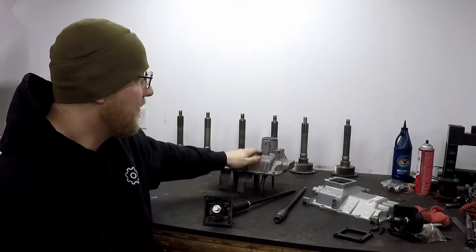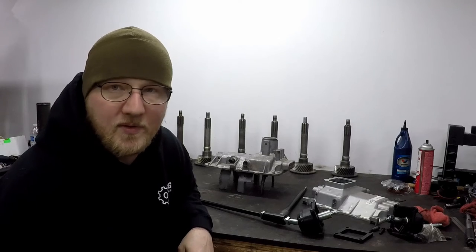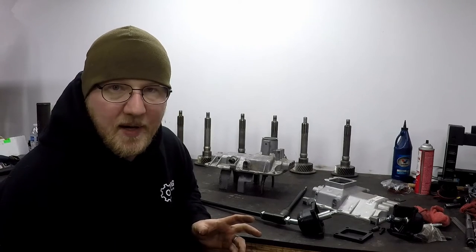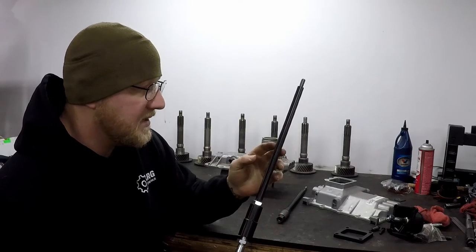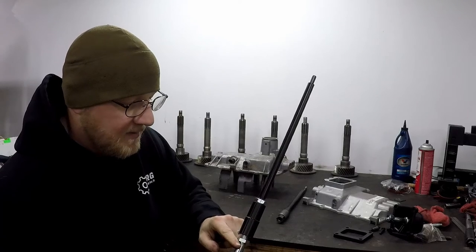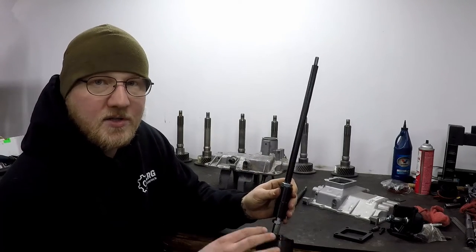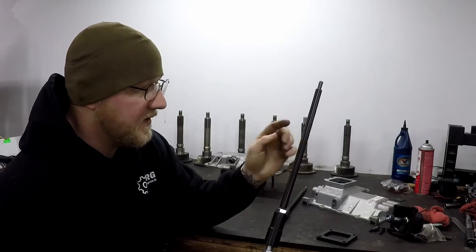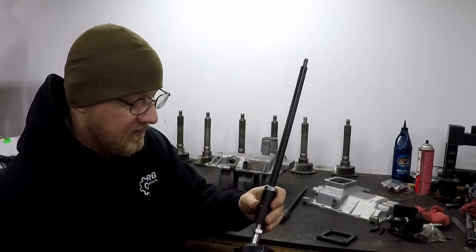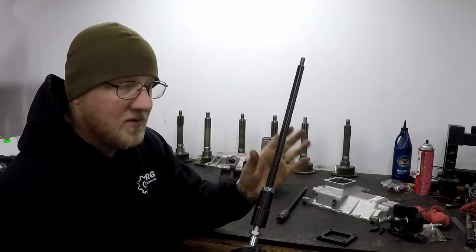That's what we do — I just wanted to share this little tip. I'm going to be doing a video about how to actually convert a round top to a square top and show what parts are necessary. The shifter part number is 334625A — I believe without the 'A' at the end that is the Dodge spec one, so make sure to add the A and you'll get the GM threaded rod which is way cheaper. Then go to Advanced Adapters and get the GM NV4500 shift lever to match the GM thread. For those of you who already have a Dodge shift tower, you can get this same exact configuration from Advanced Adapters with a Dodge adapter at the bottom — it'll come with a smaller threaded portion and you can screw one of these right onto your Dodge shifter. Highly recommend it.